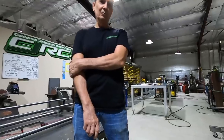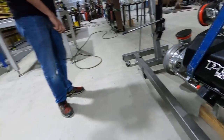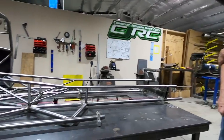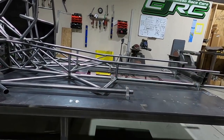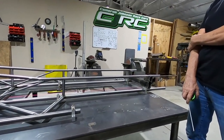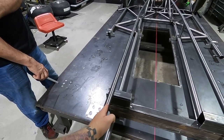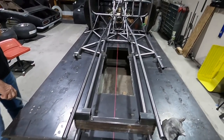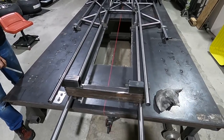On the blower cars, the rack has only one spot it can mount — it fits right between the blower, and there's only one place you can get the rack close. We have to get the motor in first because the rack goes right in there; there's no other spot for it. Once we figure that out, it'll get a ladder-type deal like in the back. On Justin's car the front was a little longer, but this Nova's front of the wheels is really short. We did some measuring this week, and instead of a cutoff with the fuel cell mount sliding in, we're going to tube across and X it, with the fuel cell actually needing to be almost two-piece to notch around the blower because it sticks so far forward.